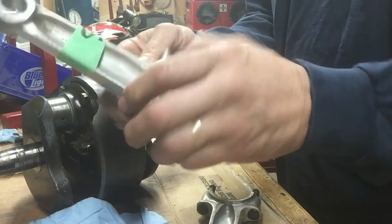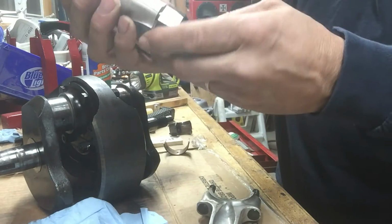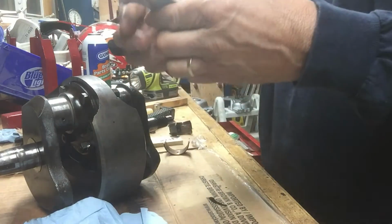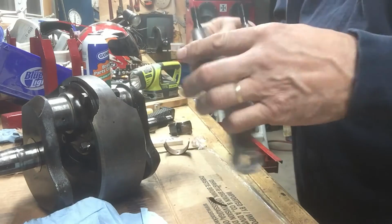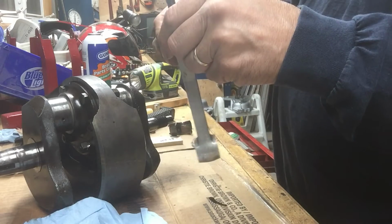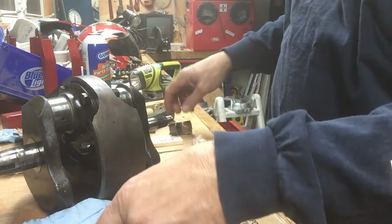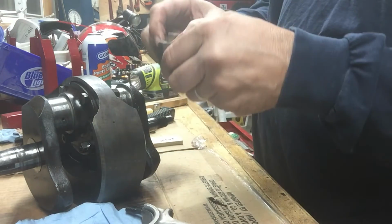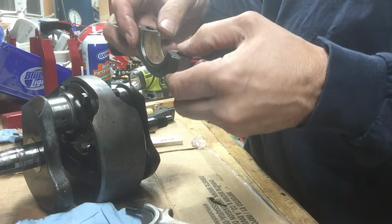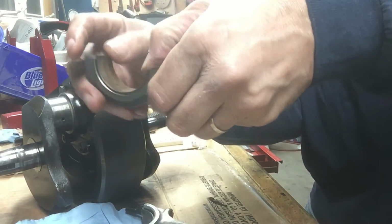Okay, I got the drive side rod off and checked. It'd probably work. Just took off the timing side connecting rod. Checked the bearing shells on this one. Not good, not good. I gotta spend more money. This bike's eating me alive. This bearing shell, I think it even spun. And you can see it doesn't even fit in the cup right.